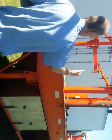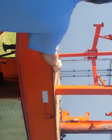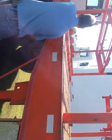All right, again, 3 foot of frame, cracks, broken welds, missing or broken bolts. Now, right here, see this bolt? Right behind that bolt, there's these wires. You can see them here. There's on this side, the trailer electrical wire and the trailer air lines.